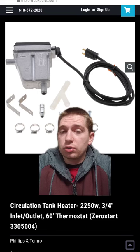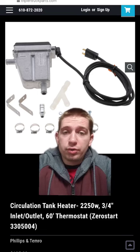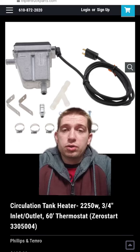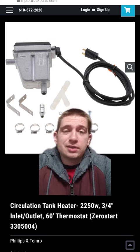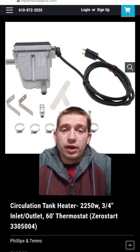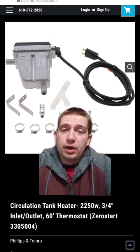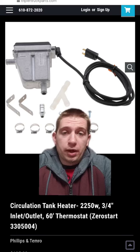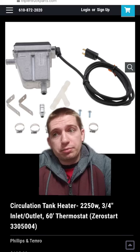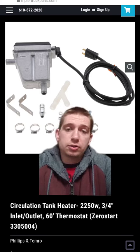Since a lot of that energy goes to warming up your battery, this will improve warming up that coolant before you even start driving. Before you go out on the winter roads, you can plug this in and it can keep the coolant in a 60 to 80 degree Fahrenheit range, so your car doesn't have to try as hard to keep the battery warm.